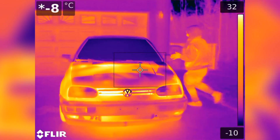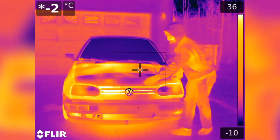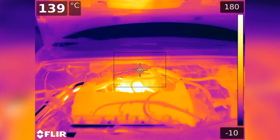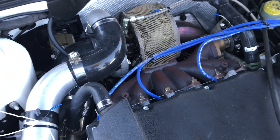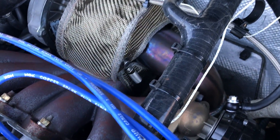The one thing you may need to actually think about is letting your engine cool down rather than going super hard and then shutting it off. If your turbocharger's really hot, that oil's no longer moving, it's sitting right there, and then it would likely get warmer. The other side of that, though, is that's just good turbocharger practice — whether you have a high-performance car or an average turbocharged car, blanket or no blanket, that's good practice to do, period. Let your car warm down if you've been driving it like crazy.